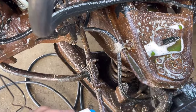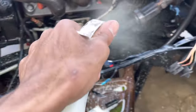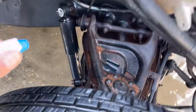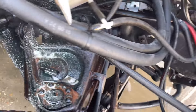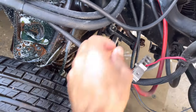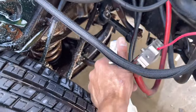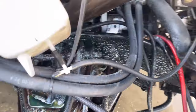Doing my second coat of the wax and grease remover, which is more of a degreaser. And this works amazing. You would think I scrubbed it after. That's why I hit it twice. First time, it damn near gets it all off, but this just guarantees it. Let's really double check, and then we'll adhesion promote everything, and we'll be good to go.